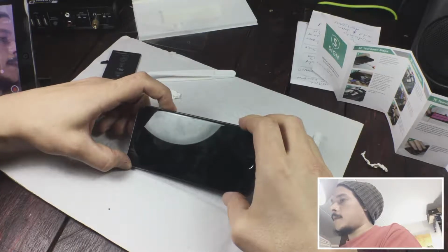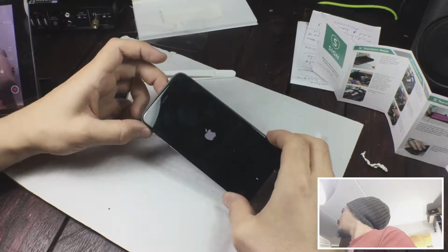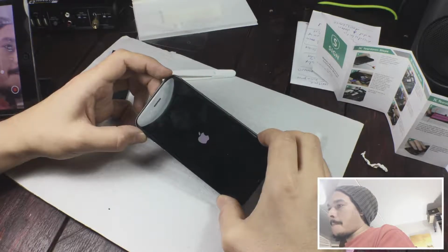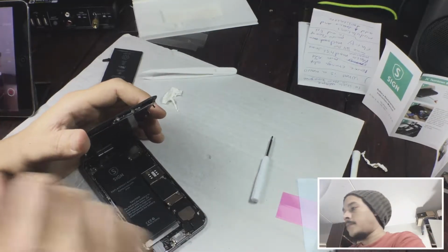Once the battery connector and the screen and everything are in there, you want to just fold down the screen and turn the phone on to see that everything works. Because if you get lines or anything weird looking on the screen, then you need to redo the screen connection. You need to pop them off again and plop them down. So maybe not screw down the plate holding the connectors first, just test it out. I did, and it worked for me.